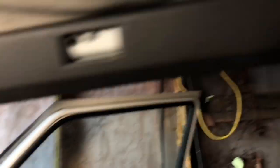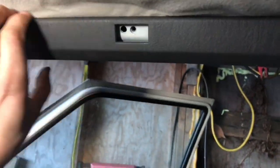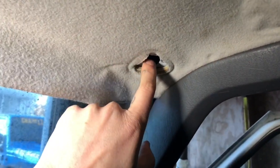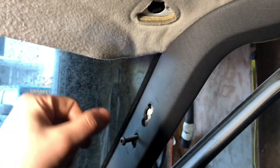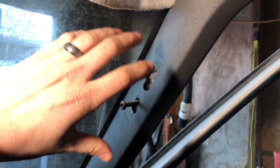If you haven't disconnected as much as mine, you'll probably need to remove the little grab handle that mounts on the side — that's just a couple of screws. This panel literally just clips in. You shouldn't have to remove your visor, but if you want to, that's just a couple of screws to get it out of your way. It gives you more room near the windshield when you're putting in the nutserts.